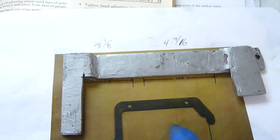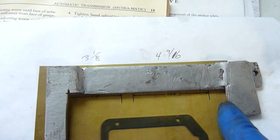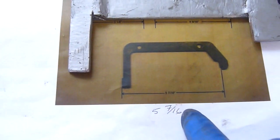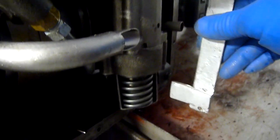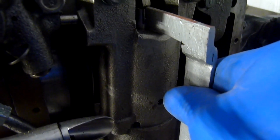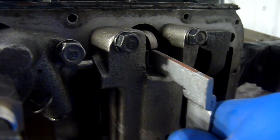This is the tool I made to take the place of that, and it does work. The distance between these two pieces is what's important — that has to be exactly correct. That dimension, shown down here, is 5 and 7 sixteenths of an inch. You take the small end, hook it on the housing, push this in, and you have to adjust it so it just contacts. That's done with this adjuster here, the rear one on the transmission case, and that pushes on the band that is in here.